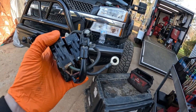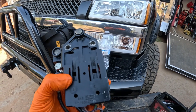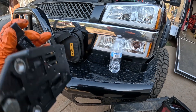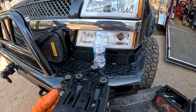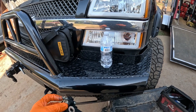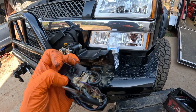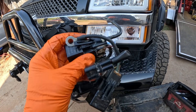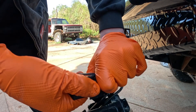So we have our relays disconnected. To do this without breaking the tabs, you need to access the window in the back and push down the tab. I had to put this in a vise to apply enough weight to push the relay out — it slides out the rear. Mine were very hard to come out, so that's one reason it's easier to pull the whole thing out. If you try this inside the truck you're going to break it. The tab is actually for the plug side — to get the relay out you just lift up on the tab and it slides out.